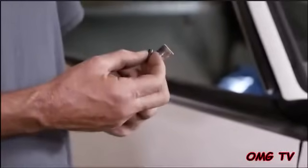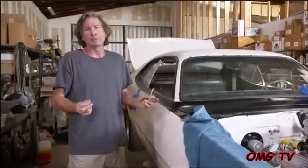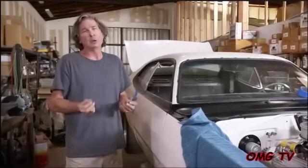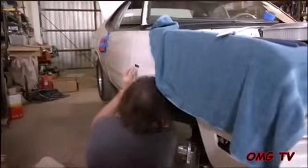I'm going to launch into something that's not super technical but is super satisfying: putting on an emblem. Originally these are retained with a one-way push-on metal clip and they're super hard to remove. Here's a little tech tip — you can use some tight-fitting vacuum hose and put a little silicone sealer inside. That'll hold it and it'll never fall off, but if you want to take it off, you can remove it pretty easily.